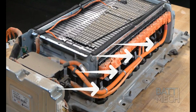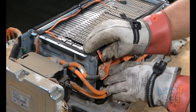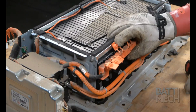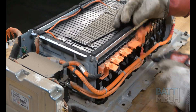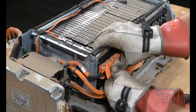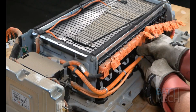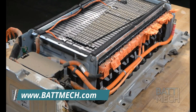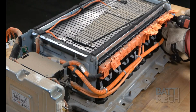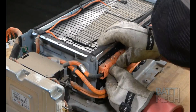Also, be sure that you have clipped the wire harness back in and onto the battery modules as shown here. After you've secured the wires to the bar with a zip tie, move to the other side of the battery pack and attach the wiring harness to the modules using the nuts. When attaching the orange wiring harness, it will re-energize the battery, so be sure to have on the proper PPE. Once all of the nuts are on tight, go ahead and close all the wiring harness covers.